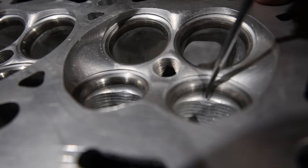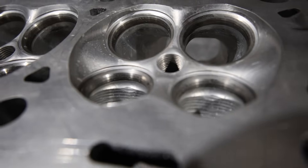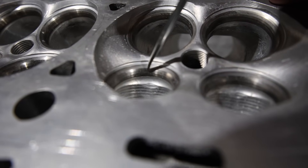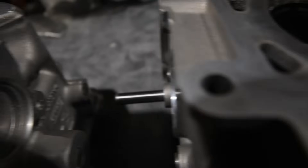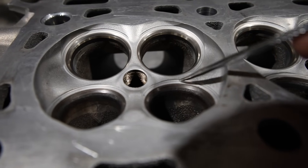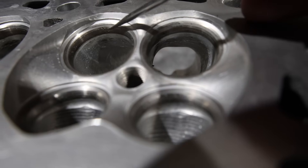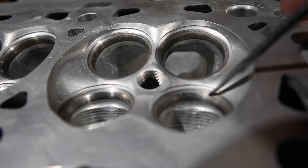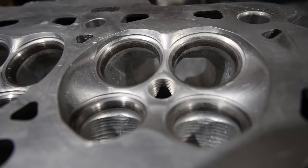You'll see that Ford had to blend in a CNC valve job — this thing is pretty gnarly. The valve job is different: they added an angle here that they didn't add on the other head. The valve job is completely different on the intake side and on the exhaust side. Everything is not as it seems — so far, I don't see how they're the same.